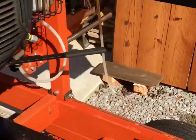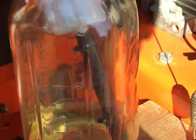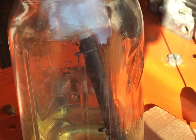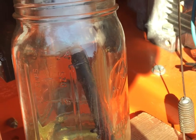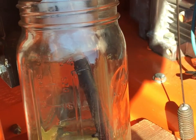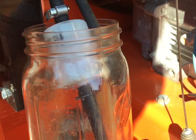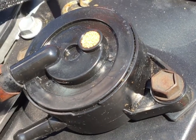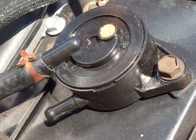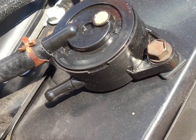So I've been doing a little bit of work on it. We put a little vacuum pump — just a cheap one from Harbor Freight, like a brake bleeder — on the end of the line coming out of the fuel filter. It would actually pull fuel through the fuel filter, but the fuel filter would not stay full. I did put a new fuel pump on it originally thinking that was the problem, but kept having the same issues. So it wasn't the fuel pump.